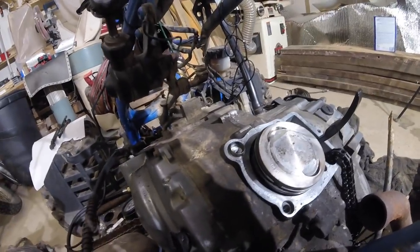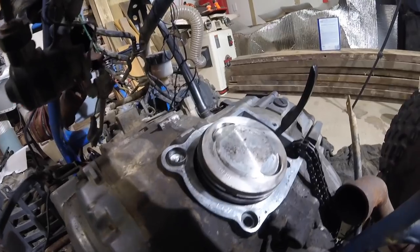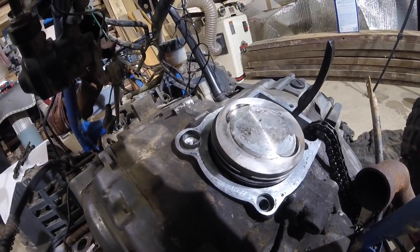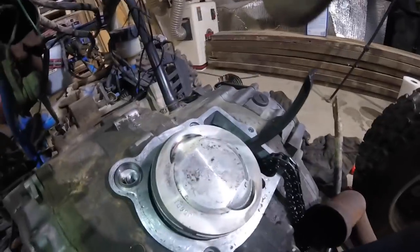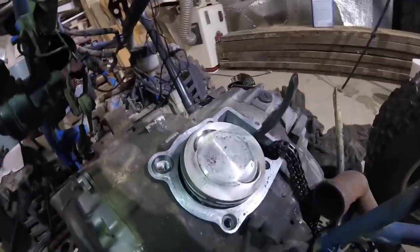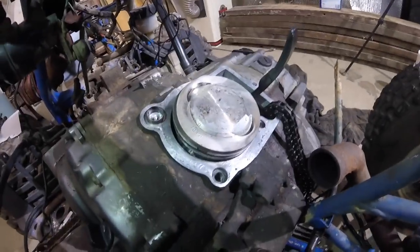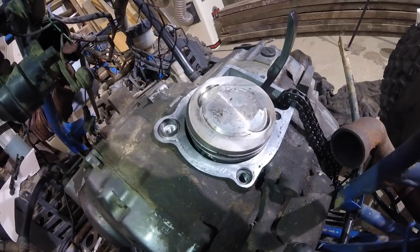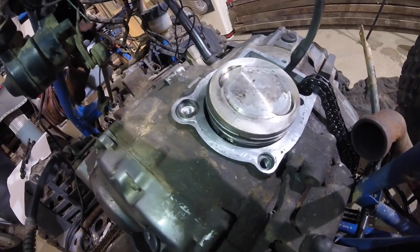This lower gasket is all cleaned up here. This took probably an hour and a half, actually. That gasket was baked on there. It was definitely the OEM because there was a part missing by the timing chain that was gooped up with some RTV. So, yeah, I used a razor blade and tried the wire wheel on the Dremel.